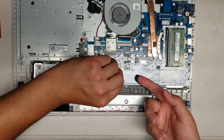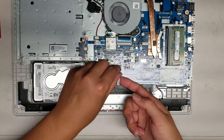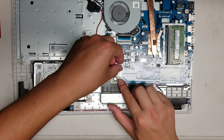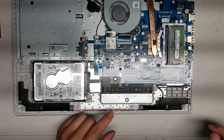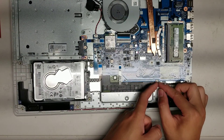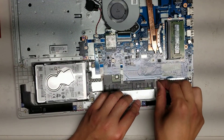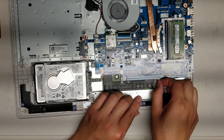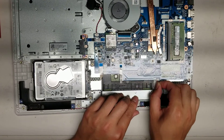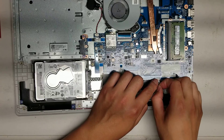Put that back in and put the latch back down. Then you got the speaker connector here. To remove the speaker, just grab the wings and then kind of wiggle it and pull it out. It is underneath the board, so if you can't reach the wings, you can grab the cable — just be careful not to flex or bend the cables too much. As you keep wiggling it, it'll slowly pull the cable out. Try and avoid pulling on the cables if you can, because some people will damage it if they do that.